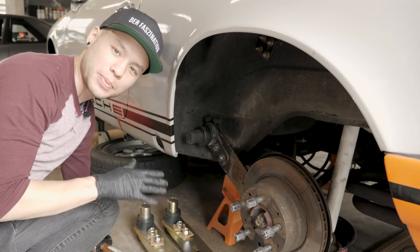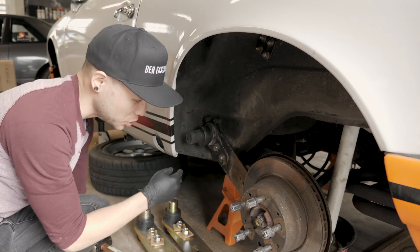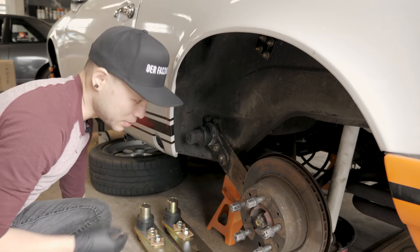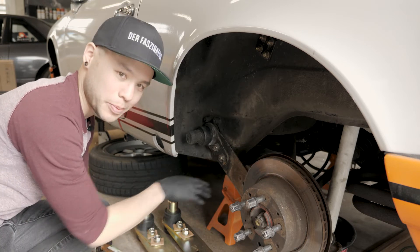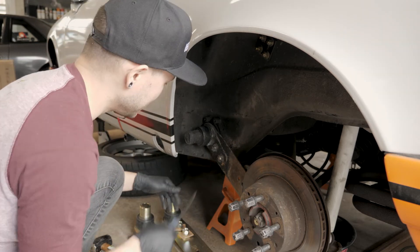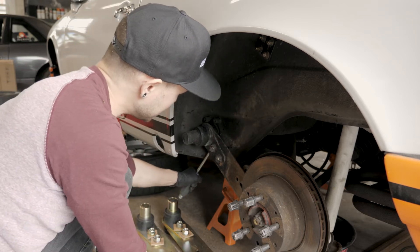As awesome as that is, here's the not awesome part of this project: getting the spring plate out and disconnecting it from the torsion bar. Most likely a lot of these torsion bars have been crammed in there for 40-plus years, which builds up corrosion and fuses them together — they're impossible. A lot of times they'll release from the inside and not from this part, and that's not a good time. I'm hoping this will be okay because I've had these off and re-indexed them several times to adjust the ride height. One of the tricks, I think, is doing a little wiggle, so I'm just going to gently wiggle this around from different sides and hopefully that helps release the torsion bar.